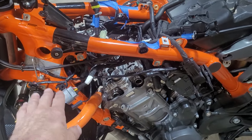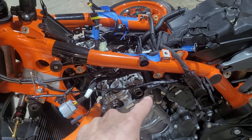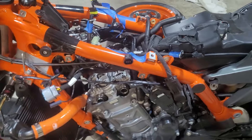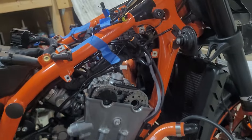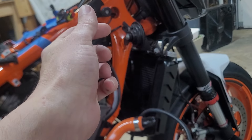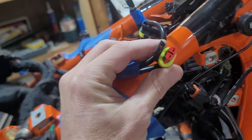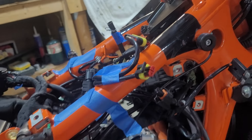On a Duke you've got these black plastic trim pieces — this one had an electrical component connected to it. Take the trim pieces off; on this side there was a canister with some hoses connected to it. Take pictures and keep up with everything. On the other side is your coolant reservoir — take it off, disconnect your hoses from the reservoir. There might be an electrical connector or two under there. Almost all of the electrical connectors are made to only go into the matching connector, so you really can't mess that up too much, especially if you're taking pictures.